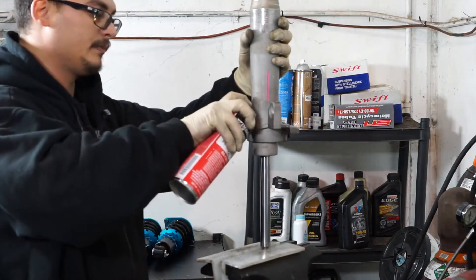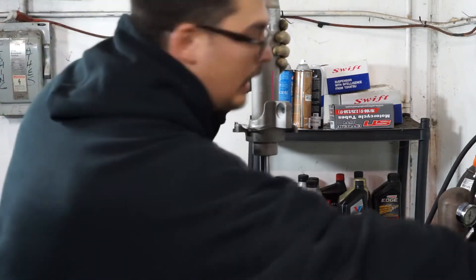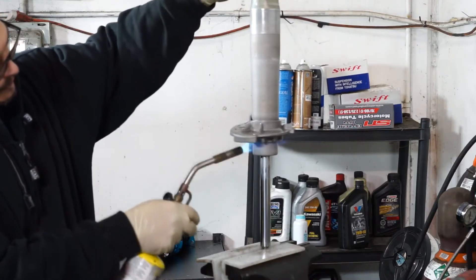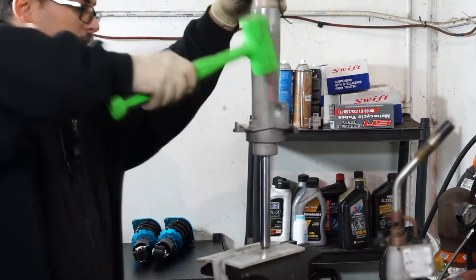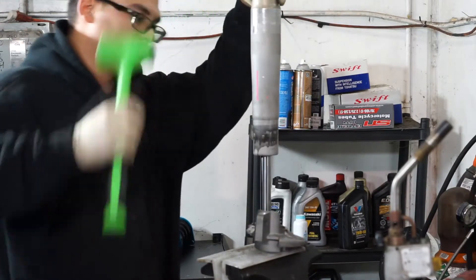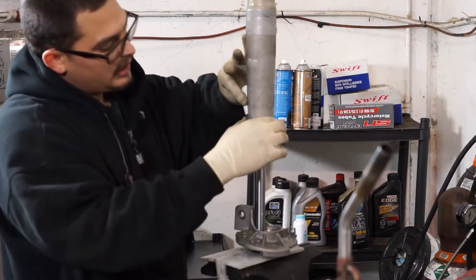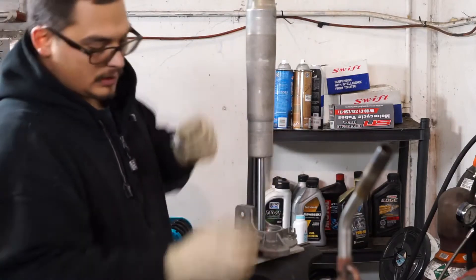With a little WD-40, add some heat from either a heat gun or a torch. You'll need to expand the spring seat to slide the seat out. Make sure the heat applied is quick and in short bursts, as any overheating may damage the strut. After heating it up, use a mallet to tap the spring seat out. Make sure to apply even hits along the seat to avoid damage. Because of the tolerances used, we recommend removing the factory stickers on the shock as the kit may make contact with these stickers and potentially jam the install of the new sleeves.